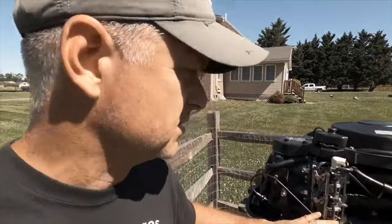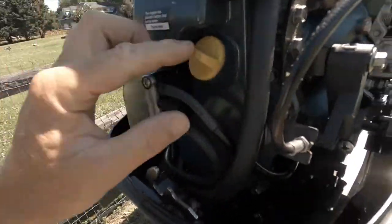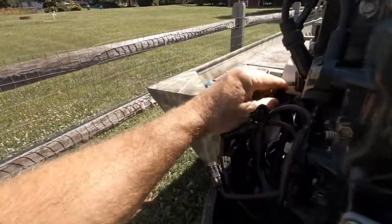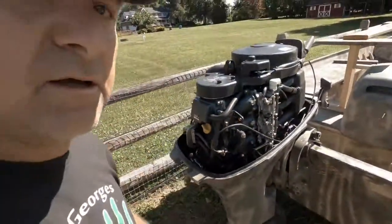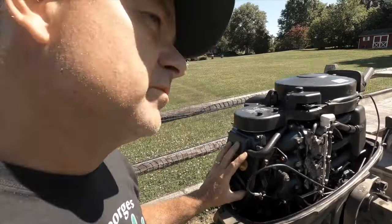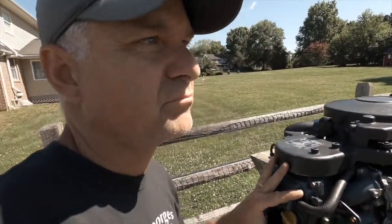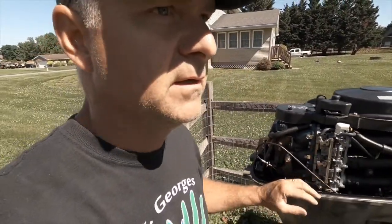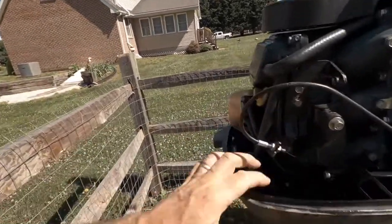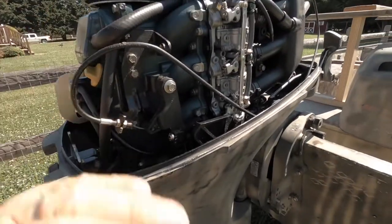Last fall I had a lot of moisture inside my valve cover — not so much in my oil dipstick, but it was definitely inside the valve cover when I checked my valve lash and valve clearance. That told me I'm getting water into my system somehow, so I did some research.